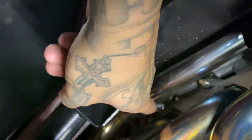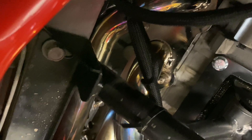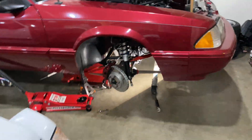I'm gonna have to take this header off. I think the hardest one — I broke them all loose — that bolt right there looks to be the most difficult one. I can't really get that one, but all these other ones are already broken loose. I'm gonna take those off, pull the header off, pull the transmission off, and then it'll be a lot easier to swap the clutch and flywheel and put it all back together.